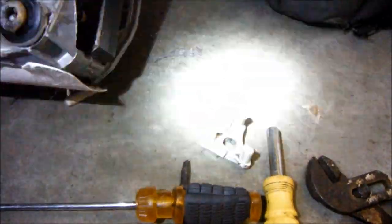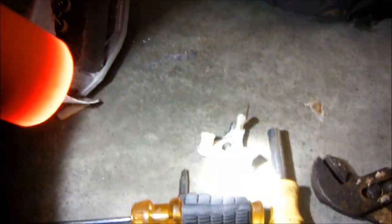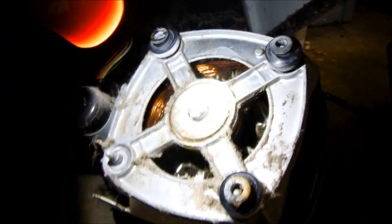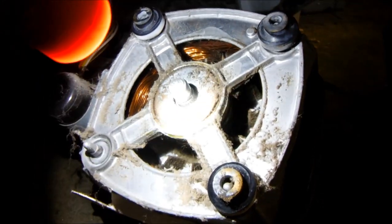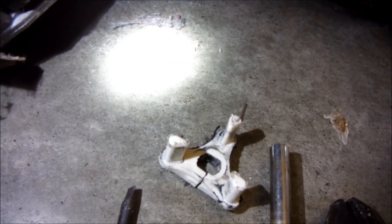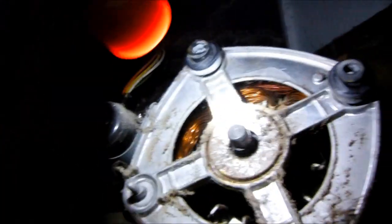Working on another coin-op. This one has a plastic drive coupler — this is the drive coupler that's supposed to be on this thing. The motor side cracked; this side's still good. This is basically the fuse. If somebody does a big load — crack — you're not going to let them damage the machine. If you put that steel one on there, you're going to put pressure on that shaft and round it off, either the motor shaft or the transmission shaft. That's why I'd rather use the plastic ones. If you do use the steel one, use the steel one on the motor shaft and the plastic one on the transmission side.